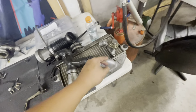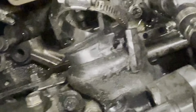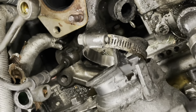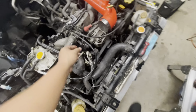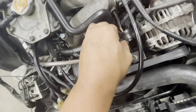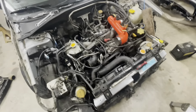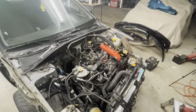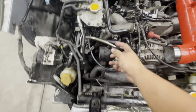I got all the intercooler out and the stock blow-off valve. I'm picking up an HKS blow-off valve tonight. The one thing that's definitely ripped is this turbo inlet — I have a brand new one right here. You can see it's completely choked, just ripped, so I was definitely losing boost. Everything was really loose on this car — no zip ties. This thing just slid in and popped right out, so I'm sure it was running no boost.